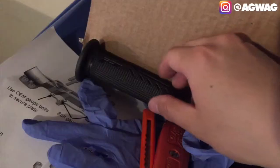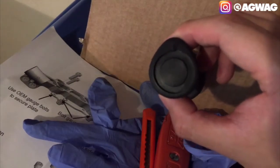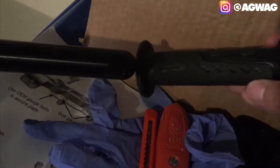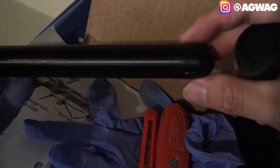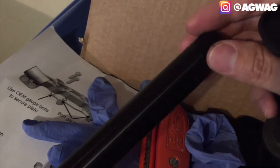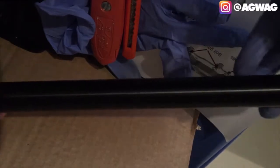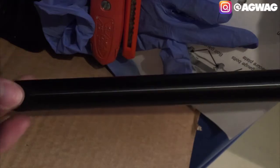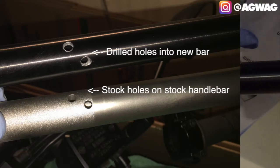While getting everything set up for the grips, I noticed the Pro Grips aren't actually cut through, so I'm going to use a utility knife or exacto knife to make a little hole so I can get it onto the handlebar and have the bar end come out. This stubby part is essentially the bar end - if your handlebar gets damaged or you go down, you only have to replace this little bar end, which you can get aftermarket and replace quickly. The downside is you'll have to pre-drill the holes again.